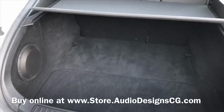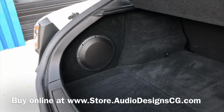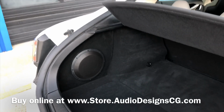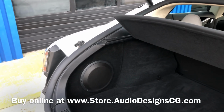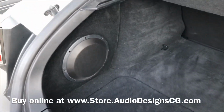In the trunk here, did a custom enclosure in the side here. It's actually a stack fab enclosure, one of our Phantom Fit boxes, so we sell those on our website as well. Basically what we do is we stack some wood up, like 3/4 inch strips of wood, so it's real strong, and then we go ahead and fiberglass the inside of it. So the box is super strong. It's a lot stronger than a fiberglass enclosure.